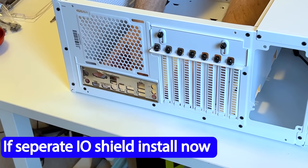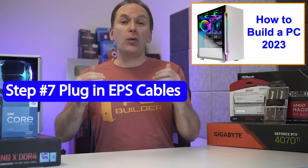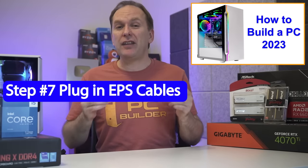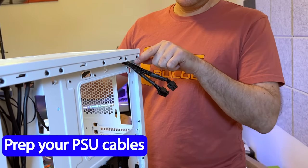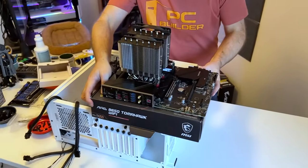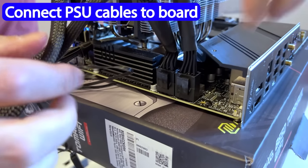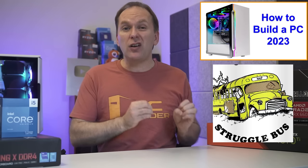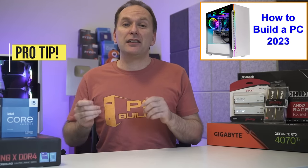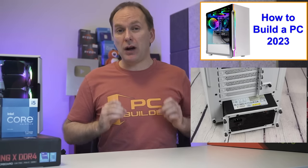Step seven — but before you get the motherboard in, get your PSU out or just the four-plus-four pin EPS cable if it's modular. Run that cable through the top rear hole, then lay the case flat and connect those cables to the motherboard. In large cases this isn't strictly necessary, but in many cases you'll struggle to connect them afterwards if you don't. Pay attention to whether your PC case has the PSU installed through the side or through the back so you can route the cable properly.